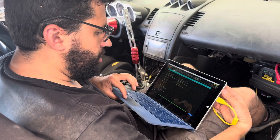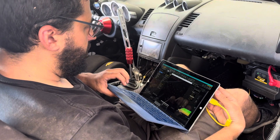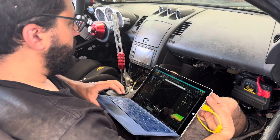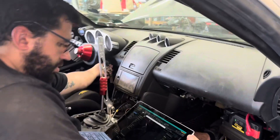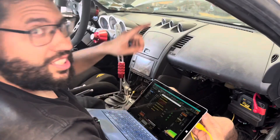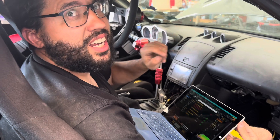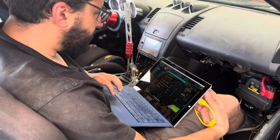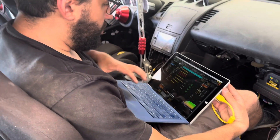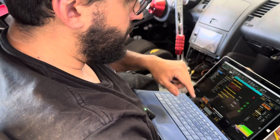Summary — we're just going to hit complete and it will reset everything. Turn on the ignition to start the setup checklist. Fuel pump primed — that's a good sign. It's checking the fans; all the fans are on the CAN and the CAN is disconnected currently, so that's different. Air temperature is working, coolant temperature is working. Oil pressure is reading zero — but it is working, it's just zero because it's not running. MAP sensor is working.